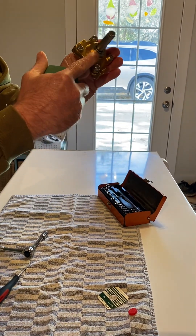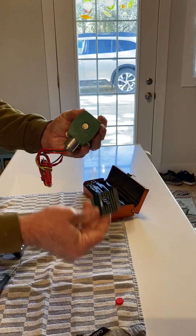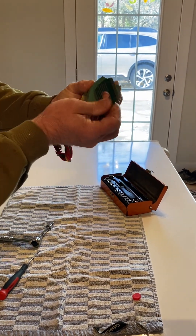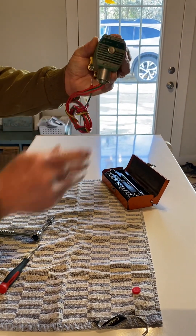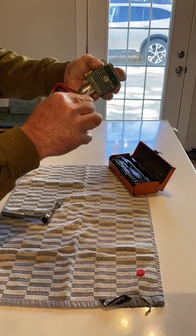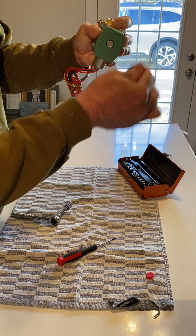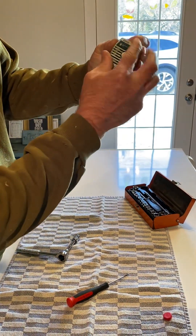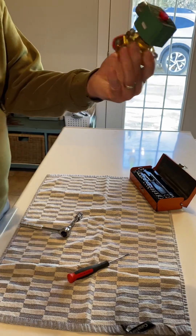Note how the backside of the power head has a groove where it sets over the socket — it goes over like that, and you're left with a little lip. Your plate — notice the size of this plate — the small part goes up here. When you compress that spring, this little plate slides right into that groove. If you get it backwards, which I've seen people do many times, the big side won't lock into place properly. Use the small side, slide it over, and snap it into place — just like that. That's how you rebuild one of these things.